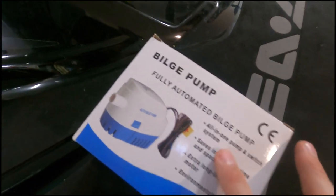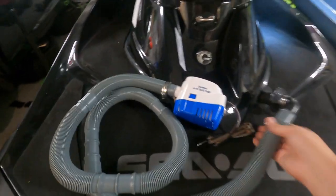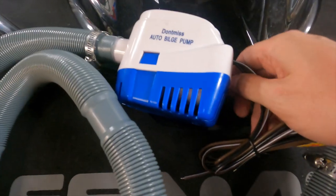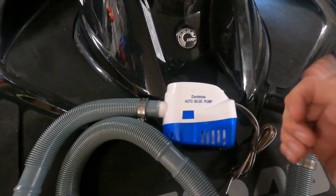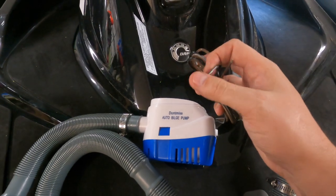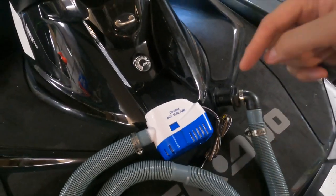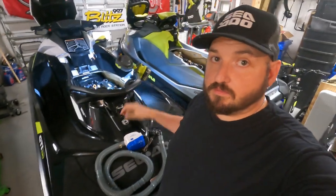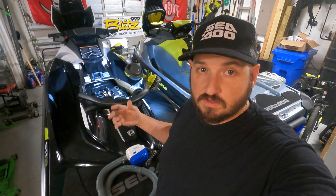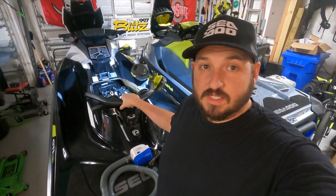This is the bilge pump I went with — it's an all-in-one pump and switch system, which is kind of true. I've taken it out of the box and hooked up this bilge pump plumbing kit that I bought separately, so it's not quite all-in-one. It's got a pretty long set of wires, and it's got a floating switch already included. But we do need a manual switch, which is why there are three wires coming off of this: one for power, one for ground, and one for the auto on/off option. I picked this up on Amazon — I'll put a link in the description. By the time you add in all the accessories plus hardware, it gets to be a little over $100 per ski, but really not a bad investment to make sure your ski doesn't sink out in the middle of the ocean.